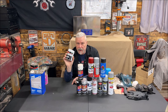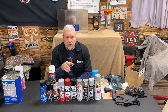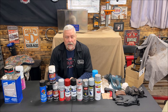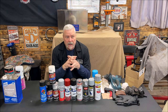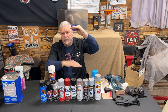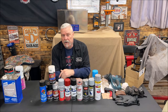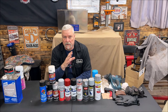This is not a finishing type of product — it's pretty brutal, it's metal reinforced. One of the most important things is ventilation. A lot of us don't have paint booths. You want the ventilation — you do not want this stuff in your lungs, skin, or eyes. If you have a garage door, prop it open about this far. Put cardboard on it with a fan in the middle pulling out for the fallout. You can also get a cheap fan and put it in a window pulling out so a lot of the fumes are leaving the garage.